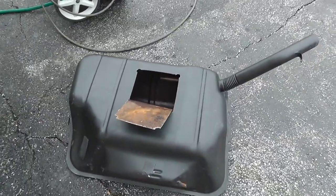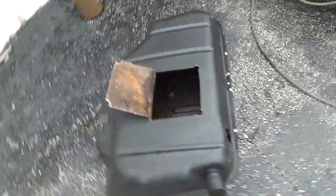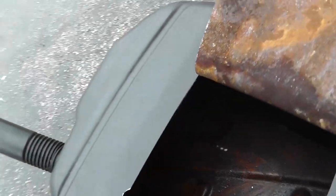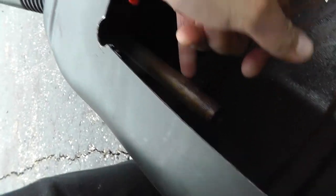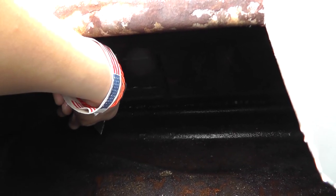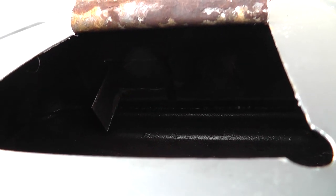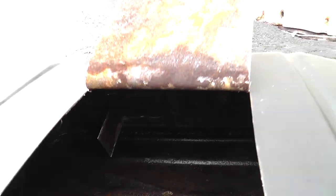So here's the gas tank. Here's the orientation in which it goes into the car, right? In your trunk. We cut it open. This line is just nothing. It just goes into this pipe, an overfill. And over there, you can see we cut it open right here as well, and in there is where the pipe is that in Audi 80 and Audi 4000, same car, takes a screen, and in Audi Coupe it does not.